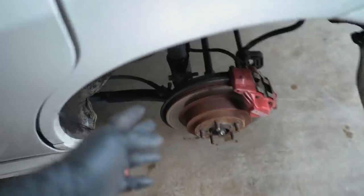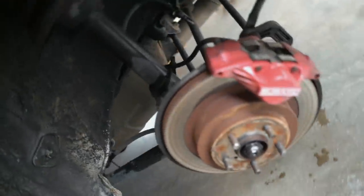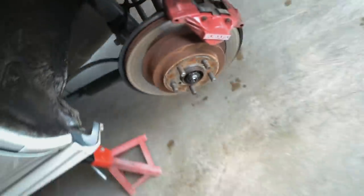As far as the rears go, we have the same two bolts down there and a little clip for the brake line — no ABS line there. But to get to the top three nuts on here, we have to pull out the rear seat lower section first, then the upper section, and then the three nuts will be right up top.